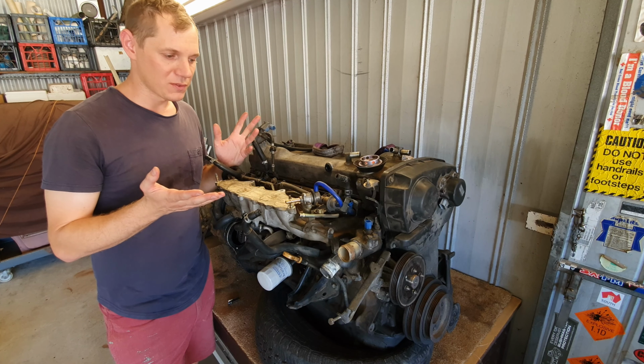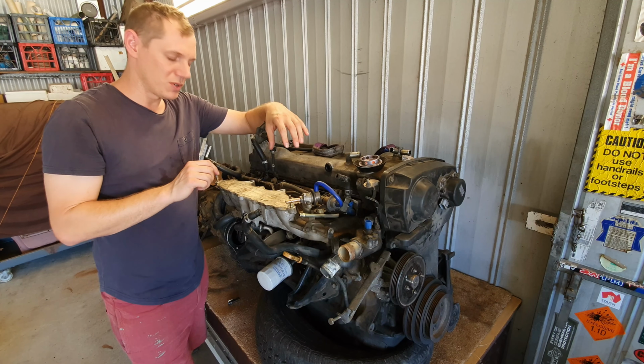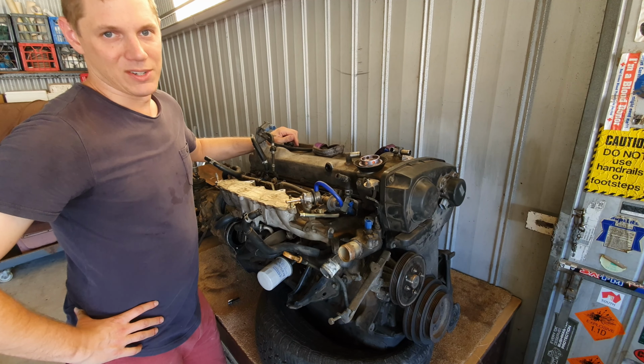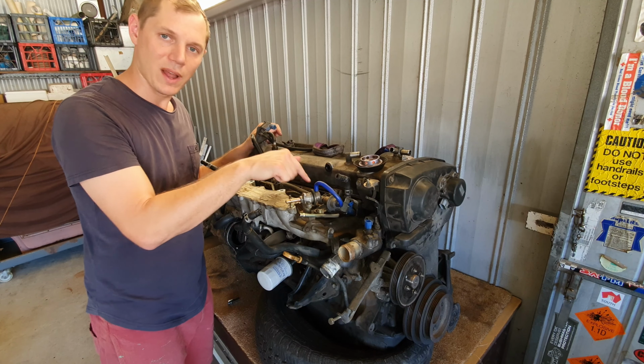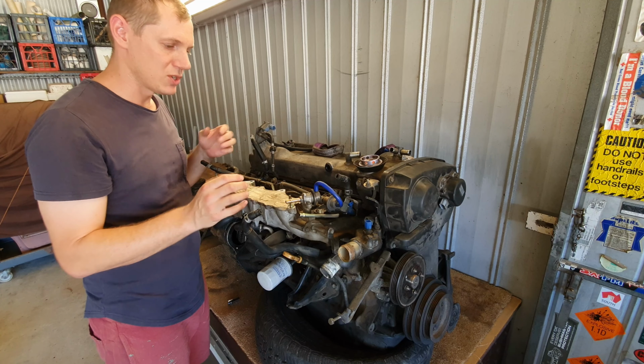So some of the positive things they have is they're all tuned length, right? So the amount of air coming in gets distributed equally to each cylinder. Very good for tuning, but there is a few downsides. With the fingers coming over like this, it is very difficult to get to your injector rail, to any wiring, aluminum bits and pieces, because you've got to then disassemble your whole clamshell to get to it.